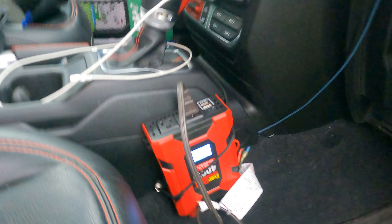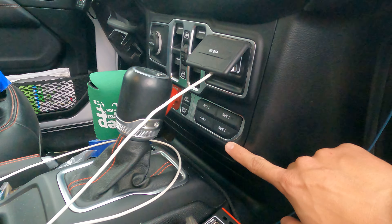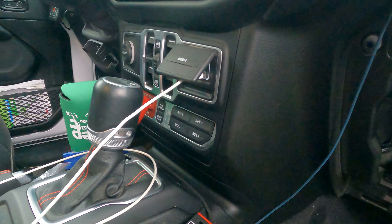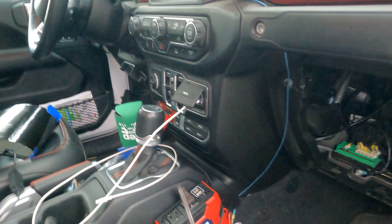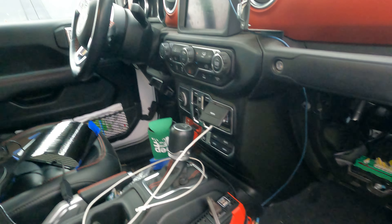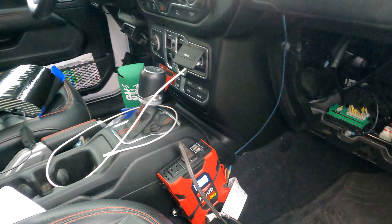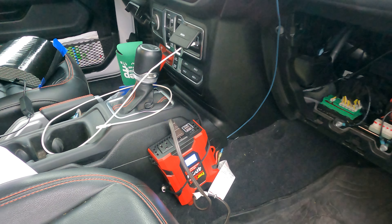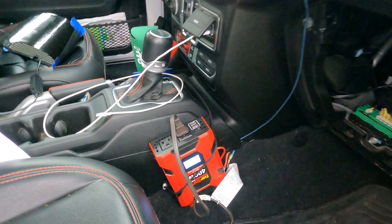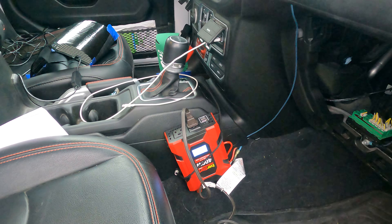I have it straight to the battery, but I could also power it to one of these switches that came with the Jeep, or if you have something aftermarket, you can just connect it to wherever the wires are for these switches — as long as you have the right power load that you can push across the fuse. If it's a 20 amp or 10 amp, you should be able to get away with it, as long as you stick with LED lights. Wherever you decide to put your inverter, ease of access is where you're going to want to start your lights.